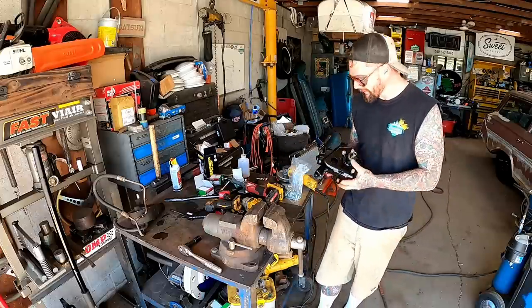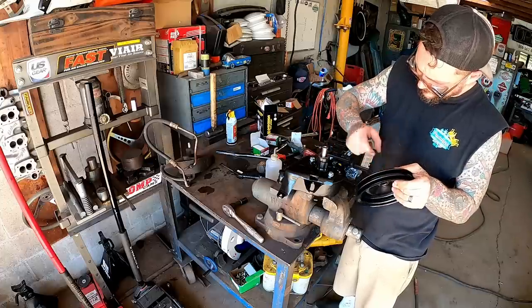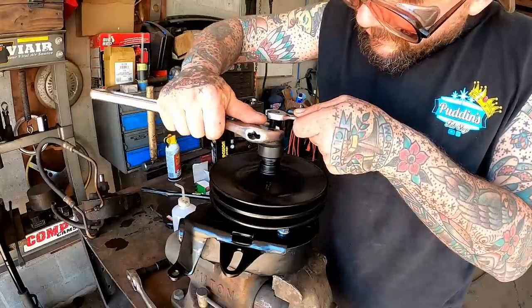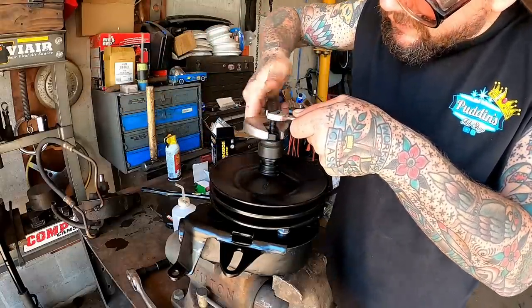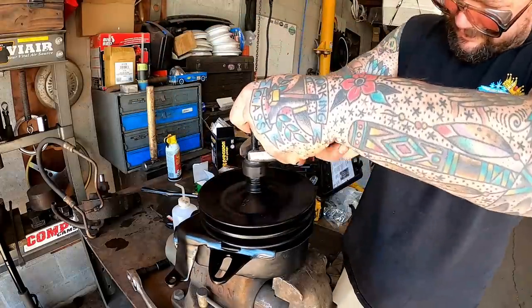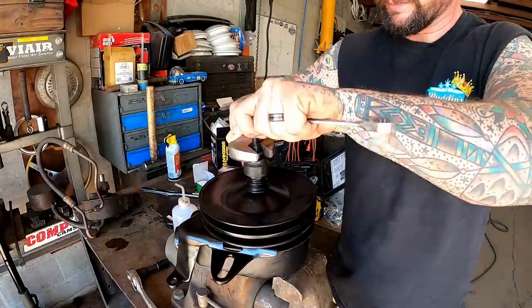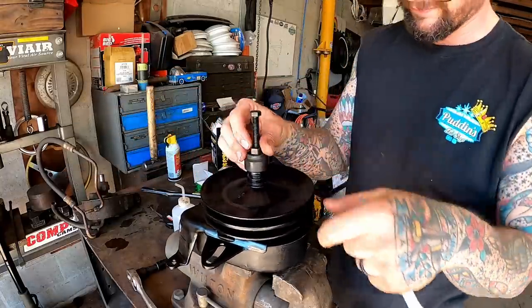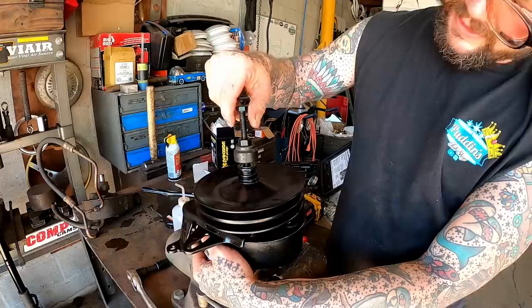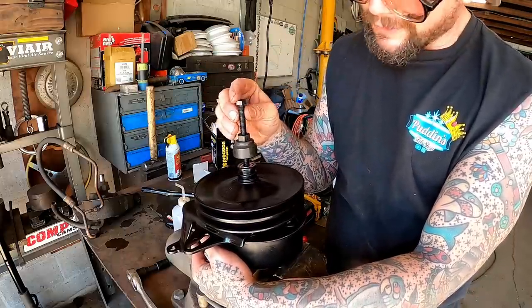Does that look pretty or what? Beautiful. It looks beautiful. I did Scotch-Brite the center to get some of our overspray out of there. That's it right there. Once you stop, you're done, guys. There ain't no sense in torquing the dog piss out of it because you'll be pressing against the shaft of the pump. You won't be doing no good.